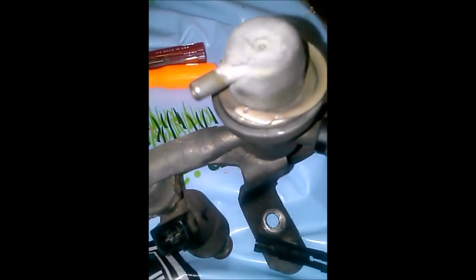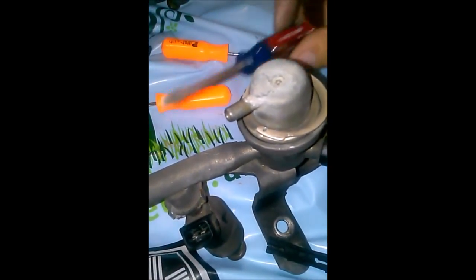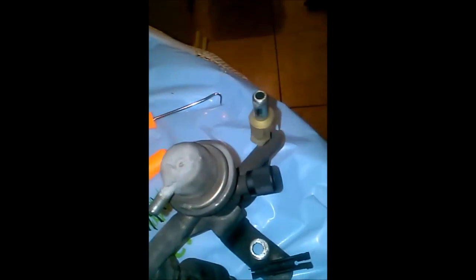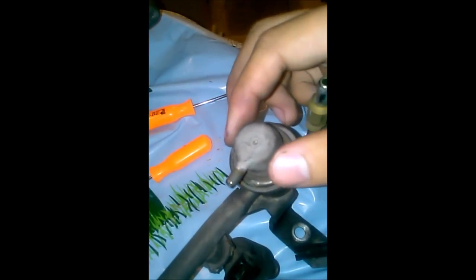What I did is I took the bent pick — which has a slightly bent end to grab onto stuff — pushed it in and put it above where the snap ring sits. Did the same thing for the other side. Then I used the straight pick to pry it up and above the lip. Once you do that, both picks will be sitting on either side and you can just pop it right off. Move that aside, and once you remove the snap ring it's pretty straightforward — you can then remove the fuel pressure regulator.